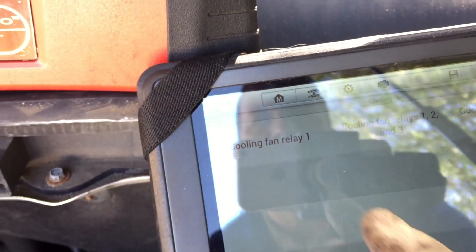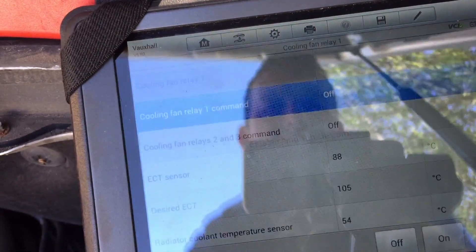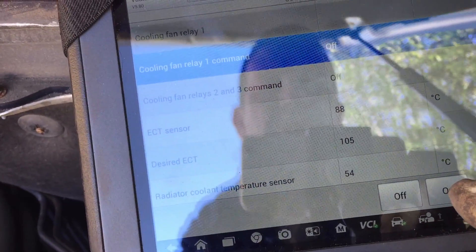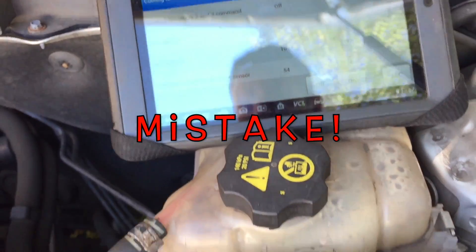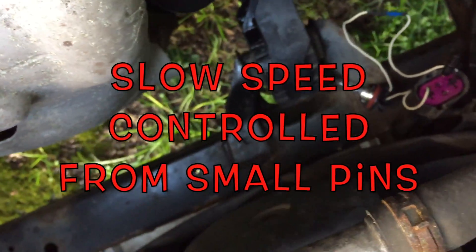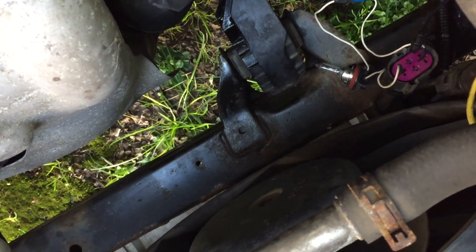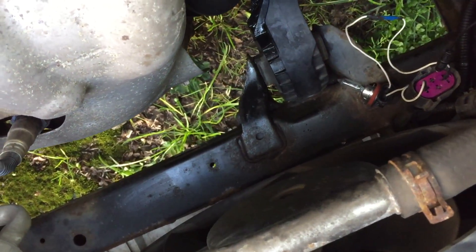There's maybe not enough here to put this test light on — maybe a smaller test light. You hear the relay box clicking but it doesn't actually bring it on. That's my four-amp test light — maybe it's too much for that. My one-amp didn't work either, but no matter. We know it's working at full speed, so the fan should come on. The fans are getting replaced.